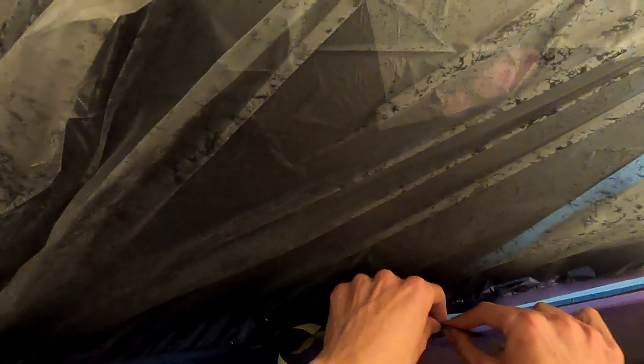On top of that, there was some bridging going on. I guess I waited too long. But when there is bridging and you start to see it stretch, you want to cut your tape like I did here, and then you can either use your finger to try to keep the plasti dip down, or you can even get a knife and cut it so that it doesn't keep tearing.